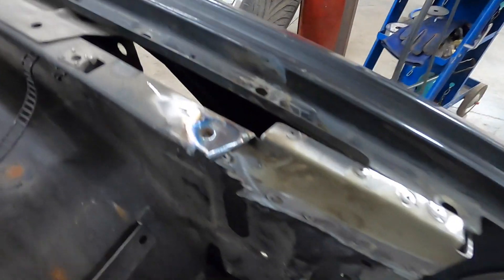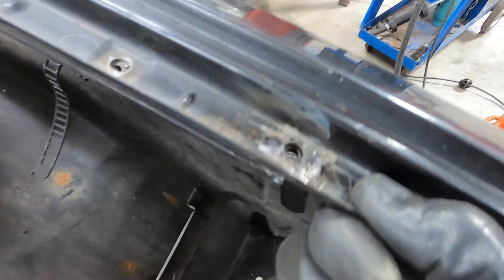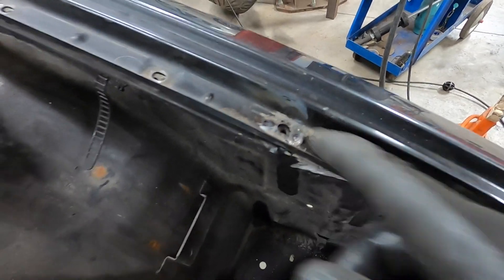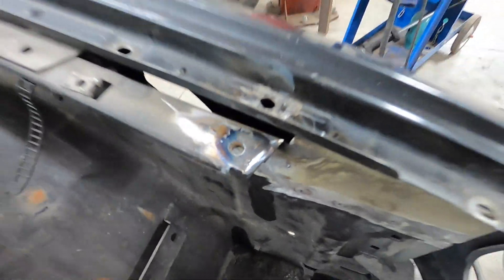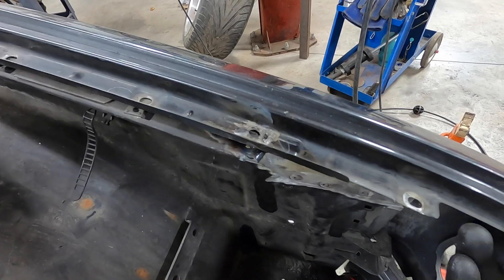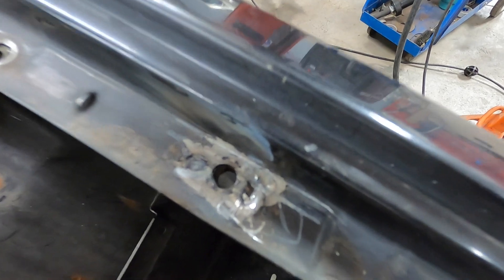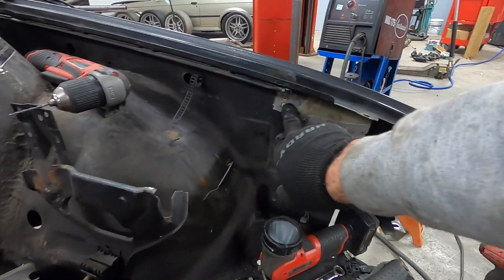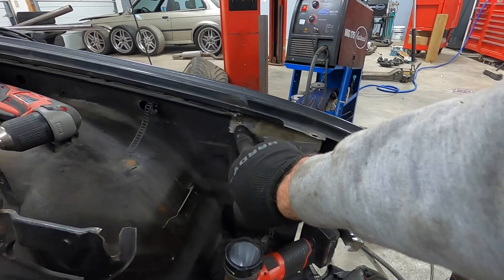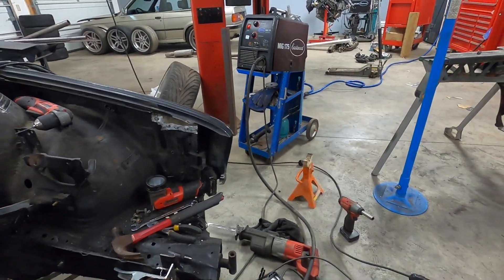Not without a little bit of trouble, but I got the first one in. This was actually pretty tough because I was welding sheet metal and ended up going through and sticking to the fender — but that's repairable. I already repaired down here off camera. The next ones will be repaired on camera. This guy actually fits pretty well, and now I'm going to put the core support on — two down here, one here, and one on the side.